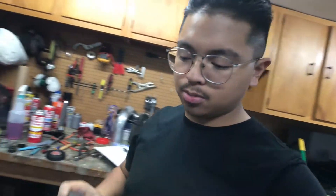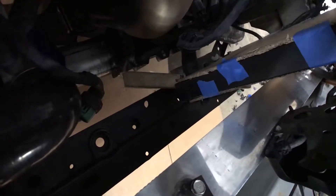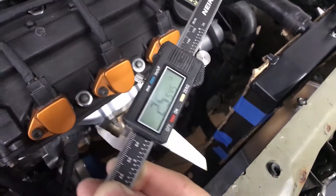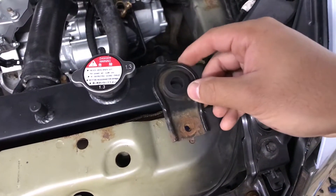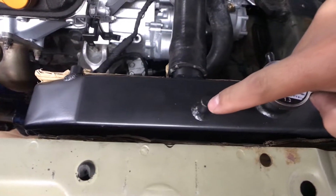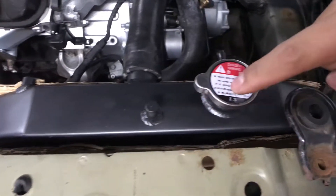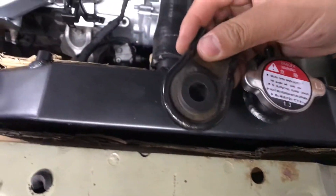So I'm going to get some measurements here with my handy dandy trusty caliper. I need to get this measurement from here to the frame of the car — about roughly 2.5 inches to the bottom surface of the radiator. On the OEM radiator, this tab slides right in, and then you have a bolt that goes right in here. And this peg is also on the OEM radiator.